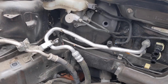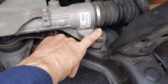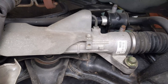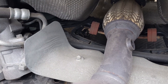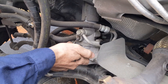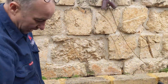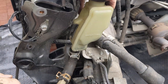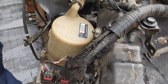Down here we've got the steering rack. To get the steering rack out there's a bolt here — those others look like they're for the sway bar so they probably don't have to come out. The steering is hydraulically assisted, so removing the hydraulic lines would mean dripping power steering fluid everywhere. The power steering pump itself lives over here on the outside of the chassis rail — that's the power steering pump reservoir and that's the pump itself. This particular one got damaged in the accident so I wasn't able to sell it.